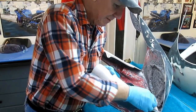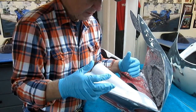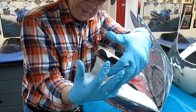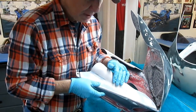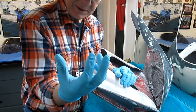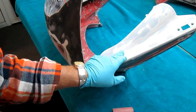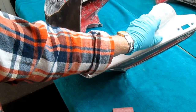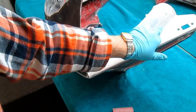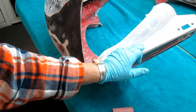If you use anything rougher than that, you wind up needing 10 coats of primer to fill in all the little gouges. But to get the primer to stick, most important thing, there's got to be a tooth for the paint. It can't be that you're painting a flat piece of glass. It's got to have a tooth, but not a tooth like a piece of 80 grit sandpaper. Whenever you have an internal radius, this is a valley. When paint shrinks, it'll tend to pull up out of the valley, and that's where you'll usually get a bubble in the paint. So it's real important that that valley have a nice tooth to it.